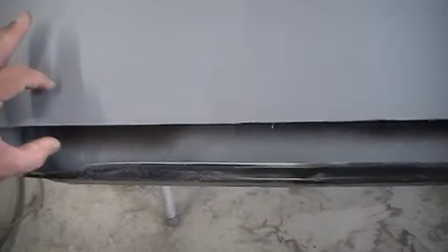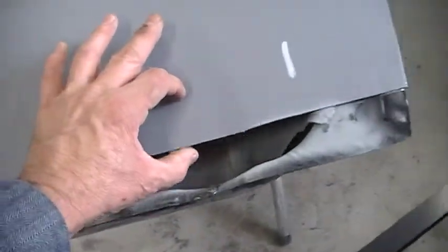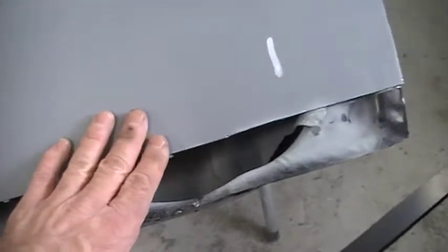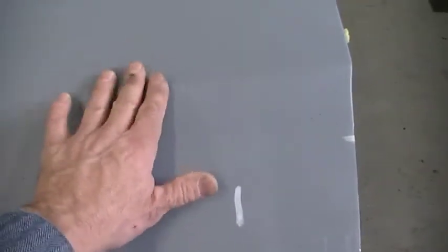maybe inch or two area here, if that weld concaves, which they usually do. It'll bow this panel down in and the new patch panel. So you usually end up with a good 1/4 to an inch of a little bit of a dip there, which is perfect for filling with body filler. No sense messing with a perfect body line on there.